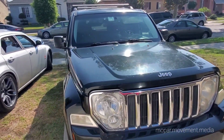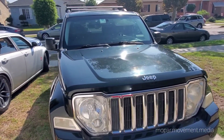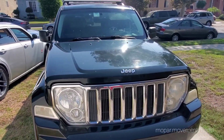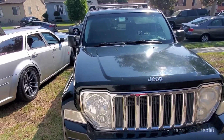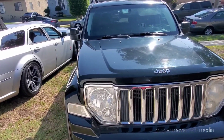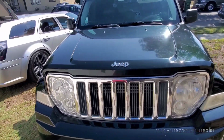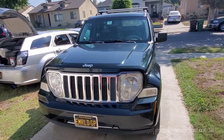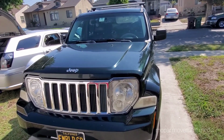Only problem I've had so far is the air conditioner box that sits in the middle of the dash. The left side has a bunch of gears and levers on it that popped off and wouldn't let the air change to vent. It would stay on defrost all the time. Anyway, bought another box, like $100. Took the parts off the side, didn't replace the box because that requires taking out the whole dash and interior. So we just replaced the gears and levers, got it working good.